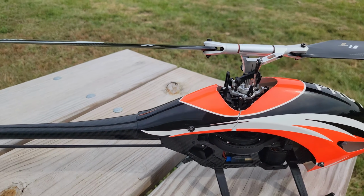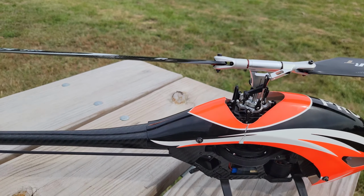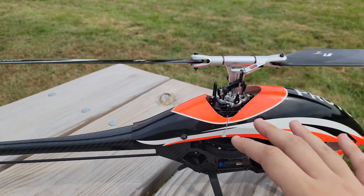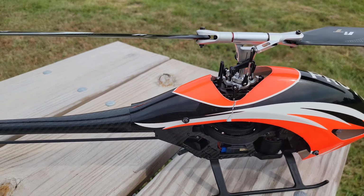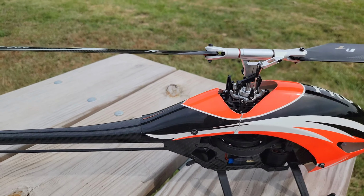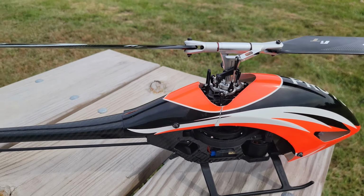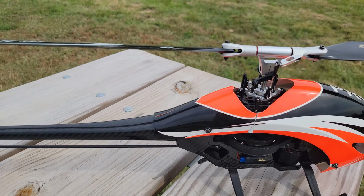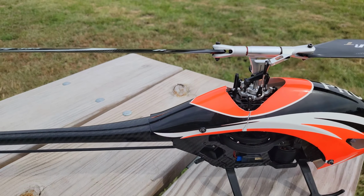380 size blade, the Aligns, the Switches, the RotorTech originals, they're not very agile. So when you, like I did on this, crank the cyclic pitch way up, while it would get the speed up a little bit, it would just sound terrible, because the blades are just sitting there stalling the entire time. Whereas this one, not only do I not have to do that because they're already pretty fast, but they're not noisy, which is awesome.